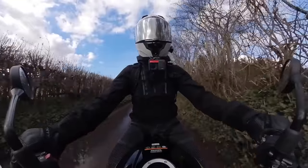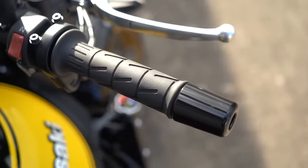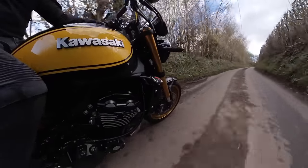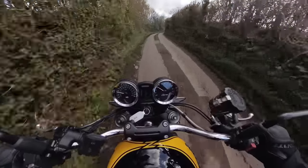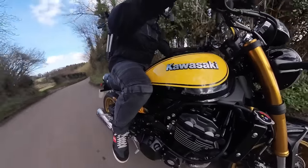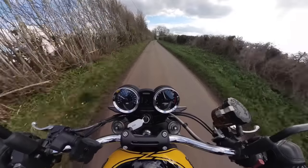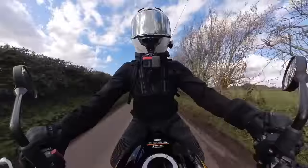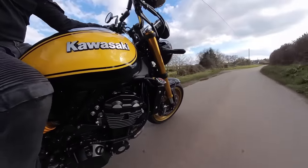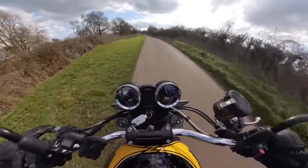The only slight drawback for me is the snatchiness of the throttle at lower speeds. It's a bit of a challenge to ride through slow corners smoothly, and low speed maneuvers are the same. This bike isn't as bad as the previous Z900RS I borrowed so maybe they've improved it a little, but it's certainly noticeable versus the competition. You could potentially remap it or get a booster plug, but I think realistically the best cure is just learning to ride around it — becoming very deft with your throttle application. Once you get the hang of it, it does become manageable and it shouldn't spoil what is otherwise a very nice engine.